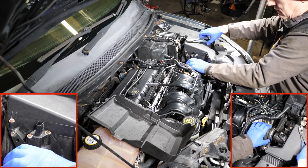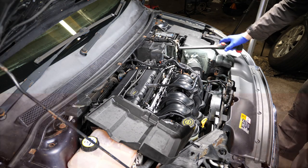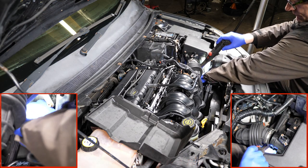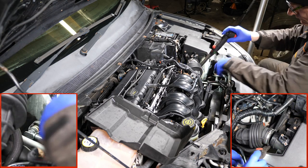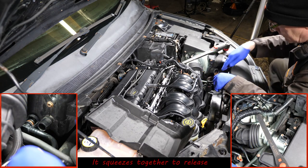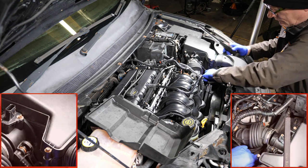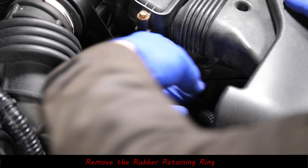With the air duct disconnected, we've also got a pipe just below that — it's a bit awkward to see. This is the crankcase ventilation hose. To remove it, just squeeze the plastic tabs together and it should just pop off. It's quite awkward — let me show you the end of this hose so you've got a better idea of what you've got to squeeze together.